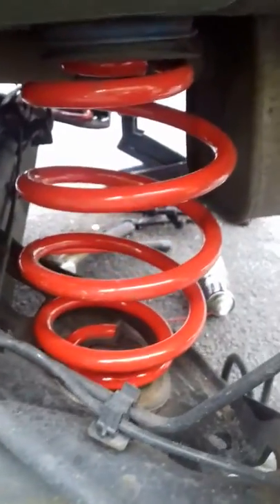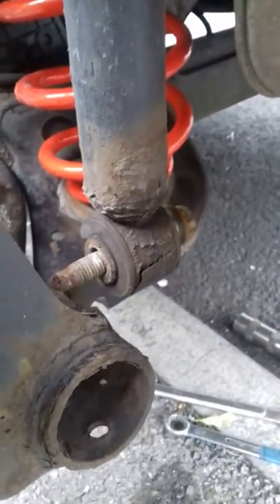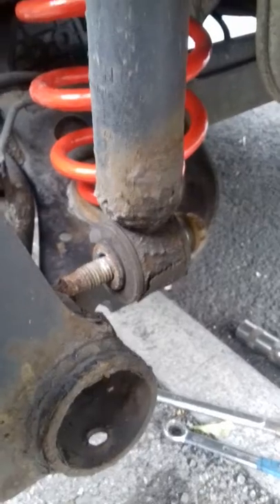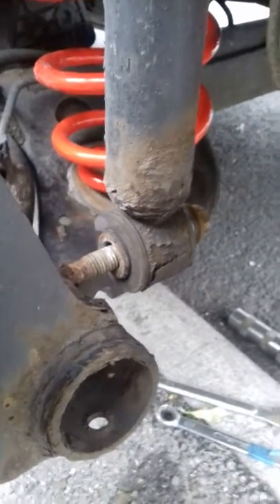Just make sure that there are no tubes or pipes being pulled unnecessarily — there's quite a lot going on along the top edge of that beam axle. All you need to do is jack up the bottom of the beam to get the shock absorber bolt back in. Put plenty of copper slip on the bolt so it comes out next time, then wheels back on, and it's on to the front.